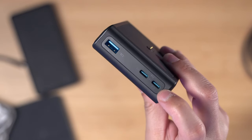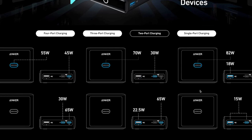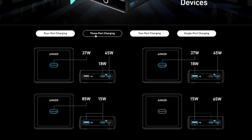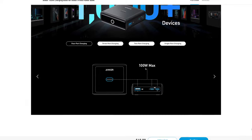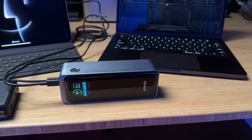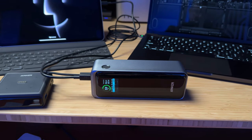If you just place the power bank on the pogo pins you get a full 100 watts of charging to the power bank. The primary USB-C port — make sure to use the one with the laptop icon — also delivers 100 watts. The secondary USB-C is 30 watts and the USB-A is 22.5 watts. With two devices plugged into the base things get complicated, and with four-port charging Anker basically gives you 100 watts total to split as needed. Having these accessible USB-C ports right on the desk is super convenient.